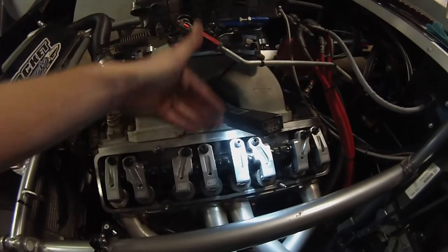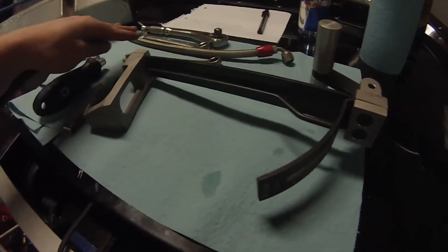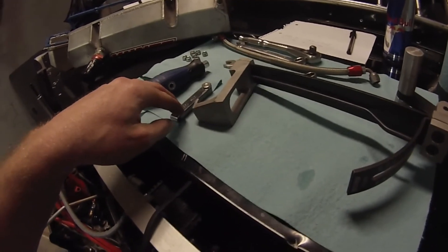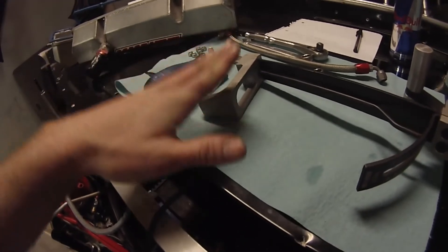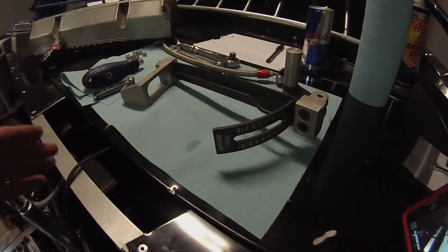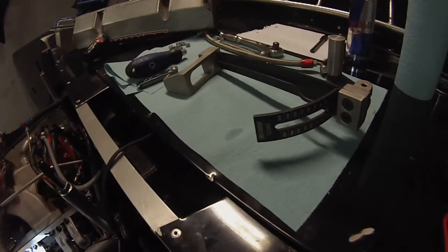Once you've inspected your valve train and see no issues, it's time to run and set your valve lash. What you'll need is a T-handle 7/16ths — though it may vary between rocker arm styles — and a feeler gauge, at least 2 thousandths minimum up to about 25 thousandths depending on your application. Also have a valve spring checker. The reason you check valve springs while setting the lash is that a weak valve spring could cause valve float, which leads to contact with the piston, potentially breaking the head off the valve and causing terminal engine failure.